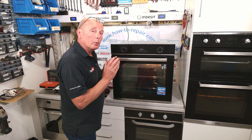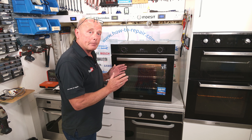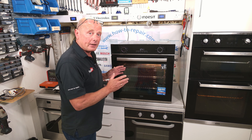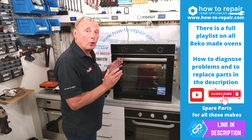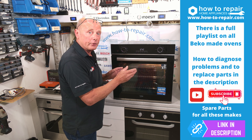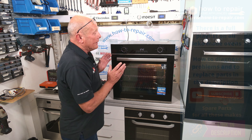This is filled with gas and controls the temperature via the gas expanding and opening the contacts on the points. If you have a more modern cooker with a circuit board, this is normally controlled with a sensor — an electronic sensor that reads the temperature in an ohms reading, and then the computer board translates that ohms reading to a temperature.